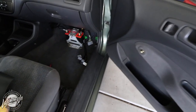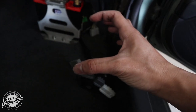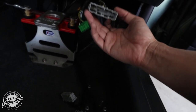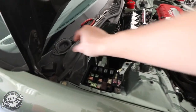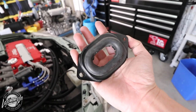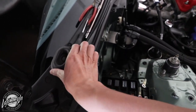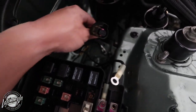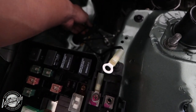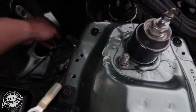I'm probably gonna unplug the ECU and do all that stuff. What I'm doing right now is actually unplugging my ECU so I can bring it back into the firewall, then put the plug or grommet in and slide everything through. I feel like the larger connector is gonna be the issue, and maybe this one also. On the grommet itself I cut out the center — it's not perfect, but with a little more cleaning it'll go right in and the harness will slide right in and look a lot nicer. I also have to unplug the fuse to the battery wire, my wideband, my starter wire, take it from there and tuck it in, and take off the ground and of course the harness.